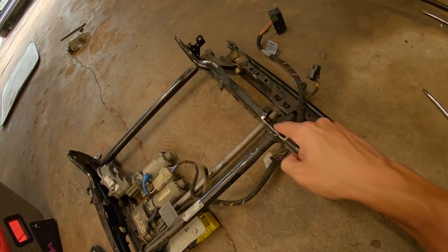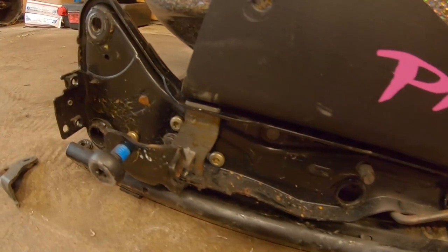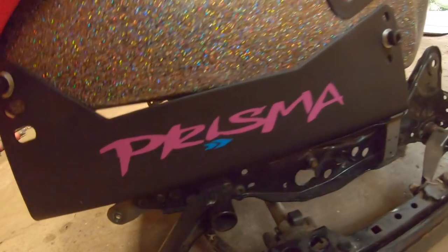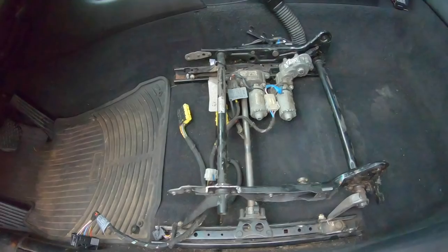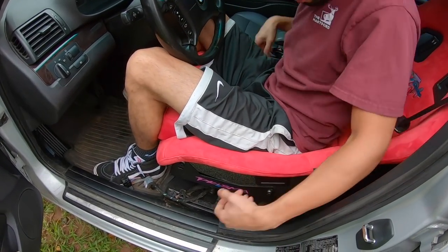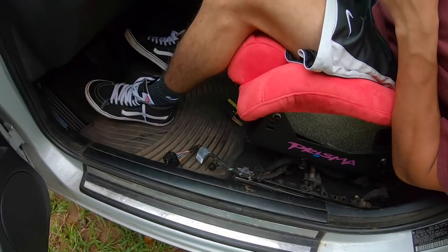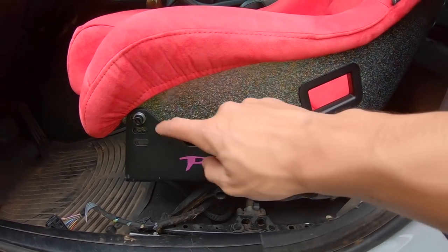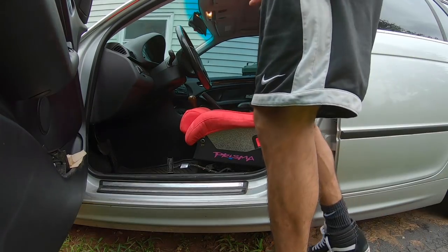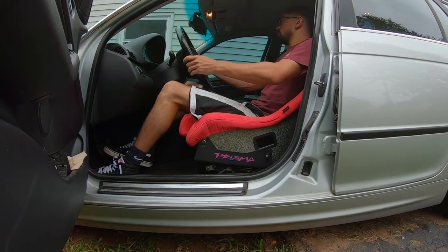I got the piece cut off and it's rough but I just want to place the seat on to see how it fits. The rail is sitting perfectly on the brackets that already come on the NRG seat on both sides — it's like it's meant for this. If I just grind it off and weld straight to it I should be good. But wait — why am I so high up? There's no way this is the lowest it'll go. I lowered it down one notch — oh yeah, that looks way better.